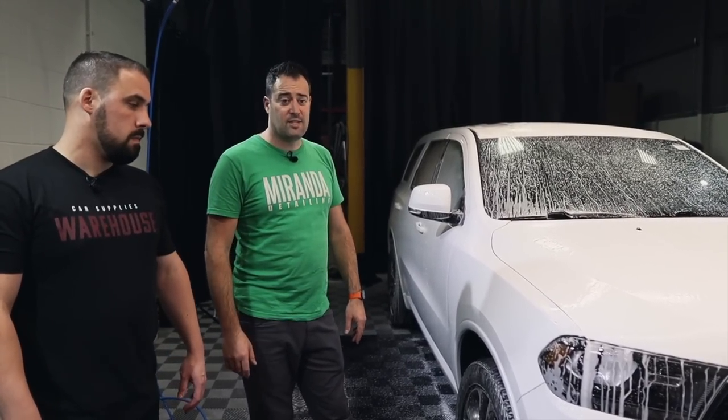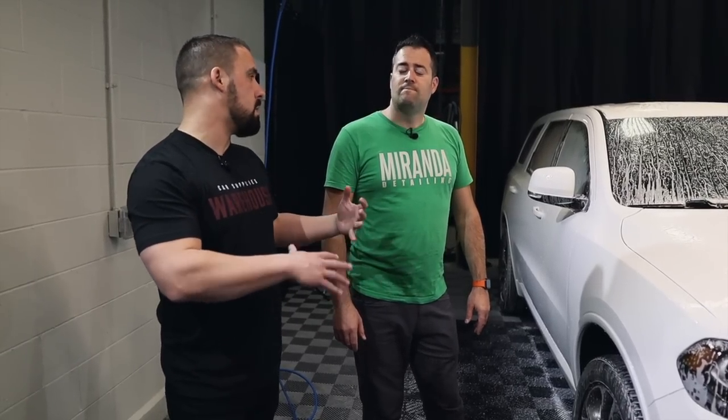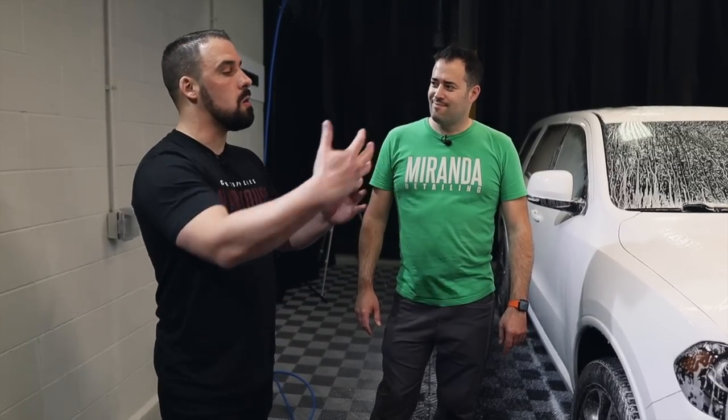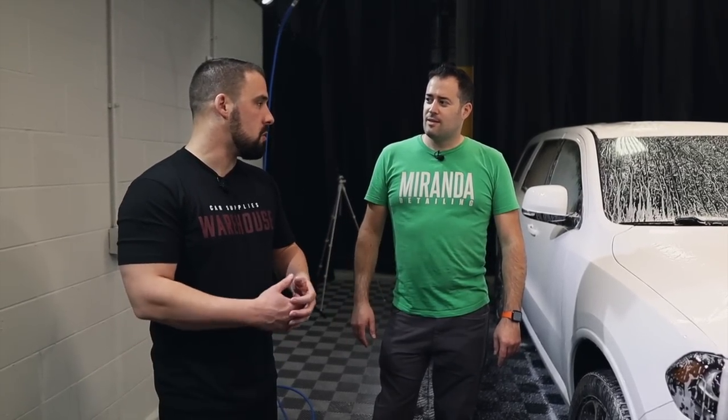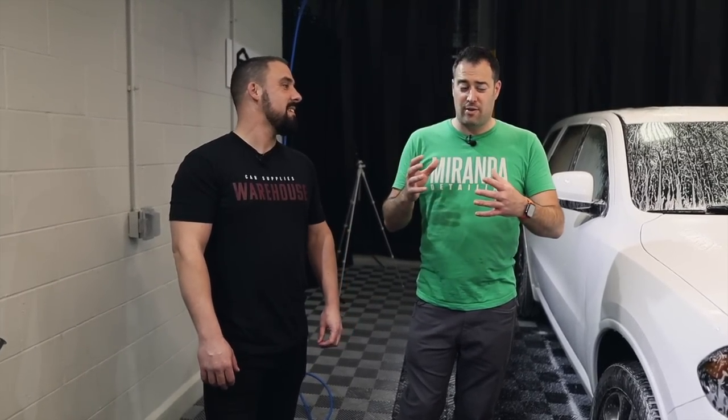In our shop we're usually doing a brand-new car or a ceramic, so we want a pH 12–13 snow foam to either declog the coating on a maintenance wash or rip through all the dirt before physically touching the car. Here's a perfect example of different demographics — different businesses, different customers, different parts of the world, different weather, humidity. We're in Richmond, Virginia dealing with heat and humidity. Don't stick too much to the rules of detailing; learn the basics and principles but adapt to your own style.